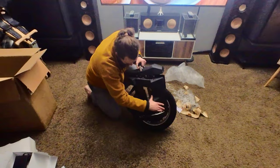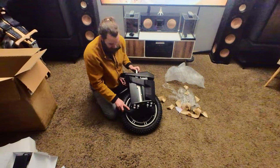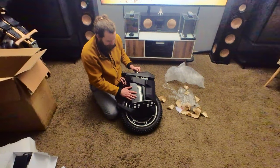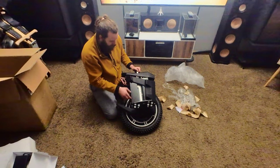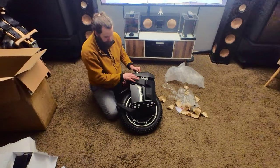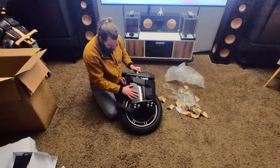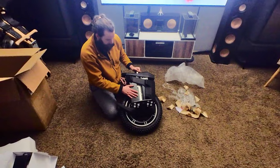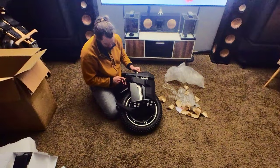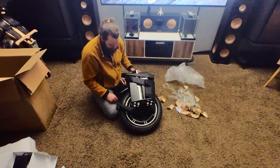Welcome back — my camera battery died. A few notes: the battery packs were completely covered in plastic from the factory, and as Chance mentioned, you actually have to take the battery packs off to get all that plastic off because you can't get to the back sides. There are two bolts on top and two on the bottom — super easy. You have enough slack with the wire to get it up, peel all the plastic off, and get them back in place. It's almost as if these things are going to be modular and you'll be able to get larger packs — that would be awesome. There are even holes up here for larger packs, which might be because it's the same chassis as the EX20S.